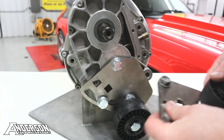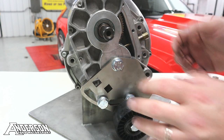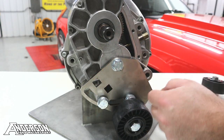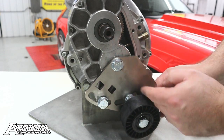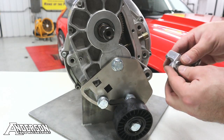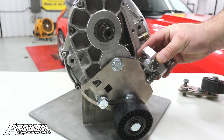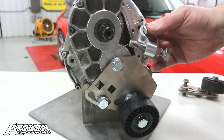You would need to cut a straight line along the bracket so this will fit — it will actually be closer to this shape to make it work. So if you have a newer style supercharger kit that has this bracket with this odd shape and bulge, all you need to do is cut it in a straight line edge to edge to be able to put the bolt and tensioner assembly back in. Once you do that, it will be fully functional and you can use this tool.